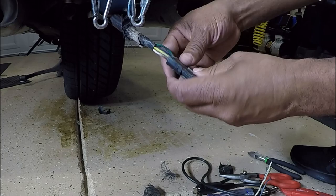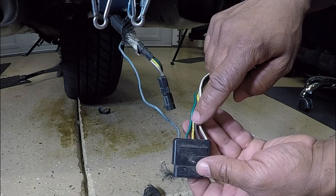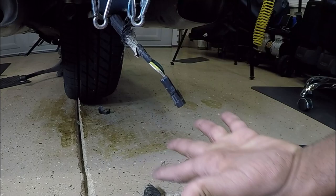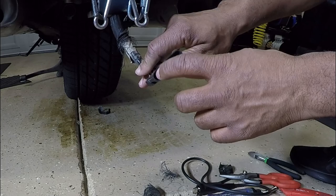So which wire is which? This is a bush-tech type plug. Looking at this five wire flat: blue is generally brakes, green is generally right turn, yellow is generally left turn, brown is generally taillights, and white is generally ground. But what if they're not colored? You're going to have to find out what each wire represents. I'm going to demonstrate how to find what each wire means, so I'm going to turn the bike on.